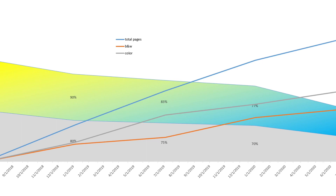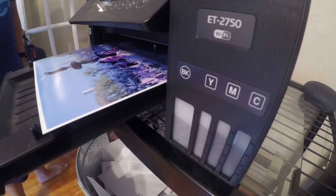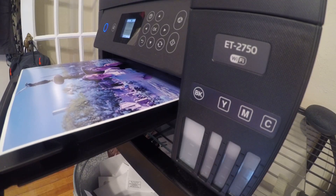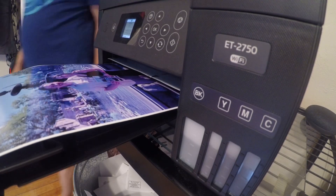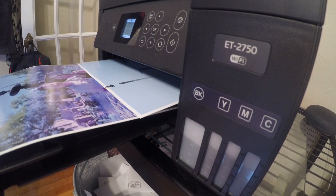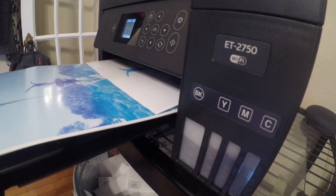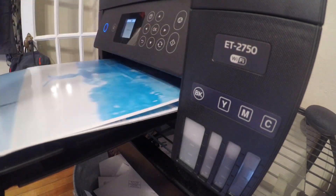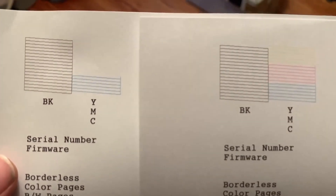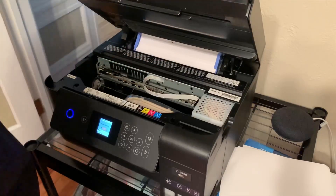This maintenance issue took me a little bit to figure out. In my 18-month video I stated I had problems — I did an overnight cleaning and it worked. But then I had another issue when printing a high-resolution photo: I got a weird smear mark on the second photo I was printing, and from that point on nothing was right. I did a nozzle check and it was clear that two of the colors were not working. I did a head cleaning a couple of times but that didn't do anything, so I powered it down and started it back up a day later — which had worked last time — but this time it did not.